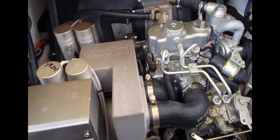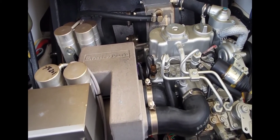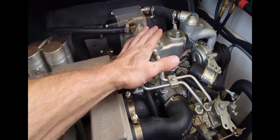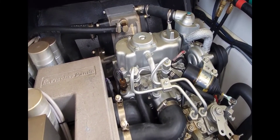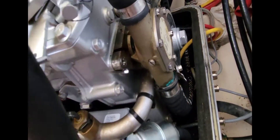Something you should remember: if this thing does not start, you shouldn't crank it more than about five times trying to start it, because it'll suck water into the exhaust — it's pumping water the whole time. If it ain't starting, you can close your valve here and try to get it running, but if you put too much water in there you're going to get it in the cylinders and hydro-lock it. I've rebuilt four or five of these because people just keep cranking and cranking thinking it's going to start, and eventually it locks up. So please don't do that.